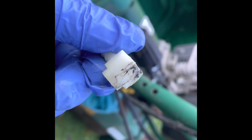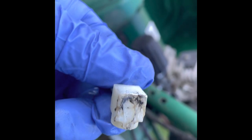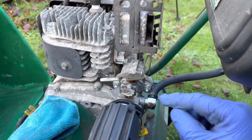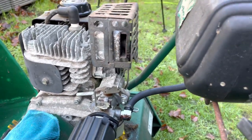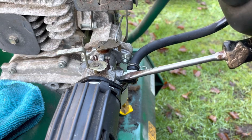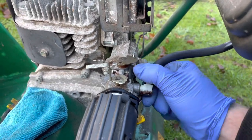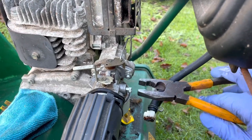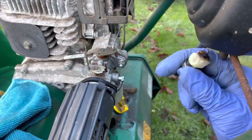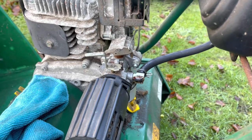I'm going to fit this and see if it leaks again off camera. If it does I'll bring you back and tell you what's happening next. Right, so after a bit of time I tried to plastic weld that — that's holding up — but unfortunately the bit that sits close to the carb is still leaking, still letting by. So unfortunately we ain't going to be able to get this one running because it's not holding a good enough seal close to the carb.